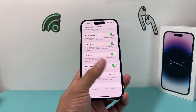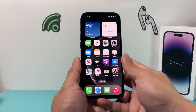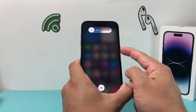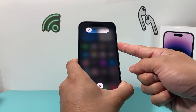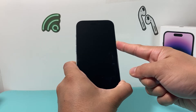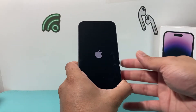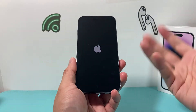The next thing you want to do if you're still having issues with your iPhone back tap not working is doing a forced restart, which is really simple. Press and release volume up, followed by pressing and releasing volume down, one after another, and then hold the side button until the screen goes completely black. Keep holding that button and wait until the Apple logo reappears, then let go. This shuts down the phone completely and reloads the code, so if it's a software-related issue, hopefully it will resolve it.